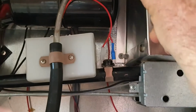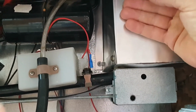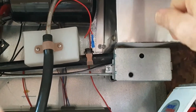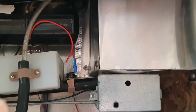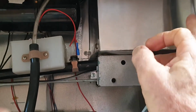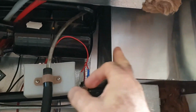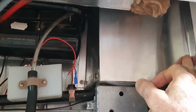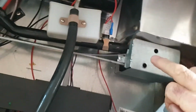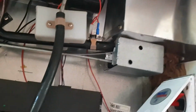So I've cut that into a strip and tucked it in behind the chimney because I can't get insulation in there, the gap's too small. So that runs the full height of this boiler. Then that is completely wrapped in the insulation material, this stuff. And then I made a shield up that holds all that in place, and that fully insulates that chimney. There's also a bottom plate here just to hold it up so it can't shake out.